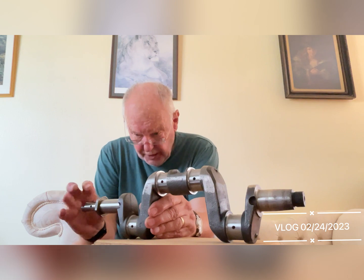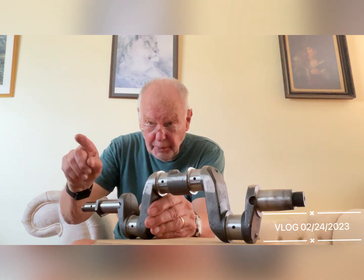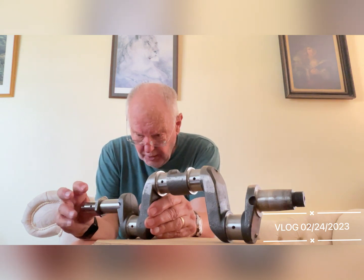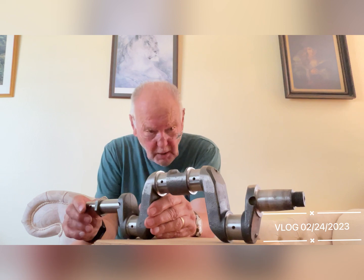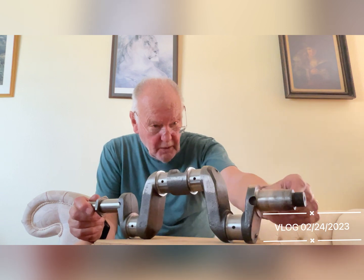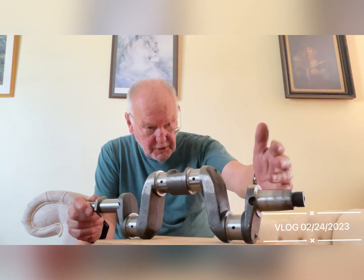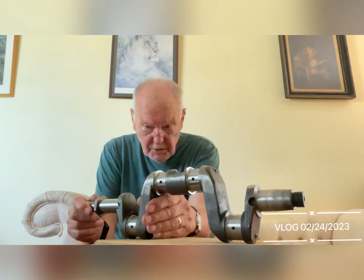What I do on mine is, because the crankshafts tend to flex, this end of the dog tends to wiggle up and down a little bit. So it's a good idea to have rubber O-rings around each end of the bearing so that it can move slightly — that gives you a little bit of compliance in the system. The same thing happens at the back, because at the back end of the crankshaft the flywheel acts like a gyroscope and it can't twist, so when that crank flexes it tends to put extra load through the back of the bearing.